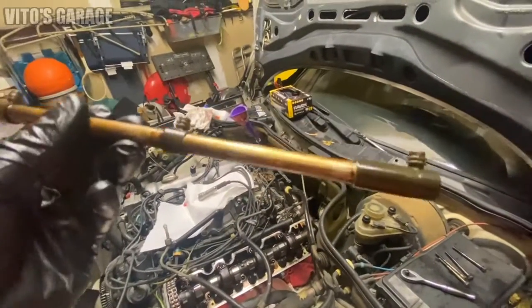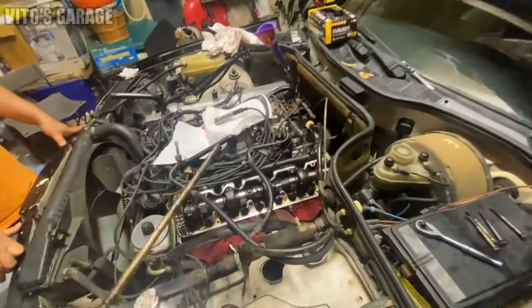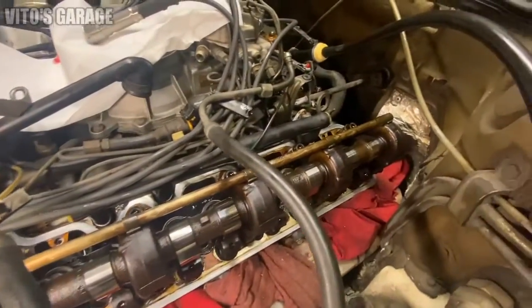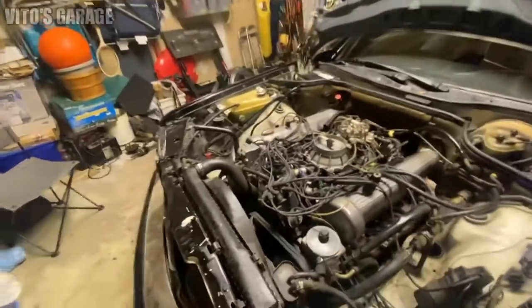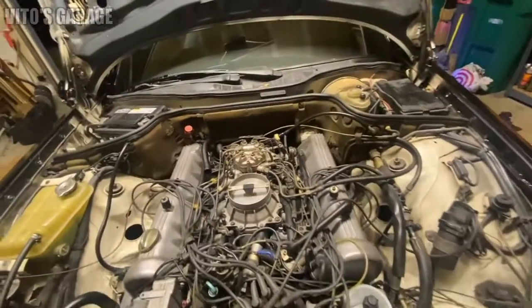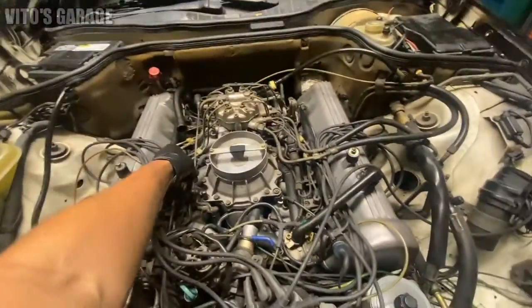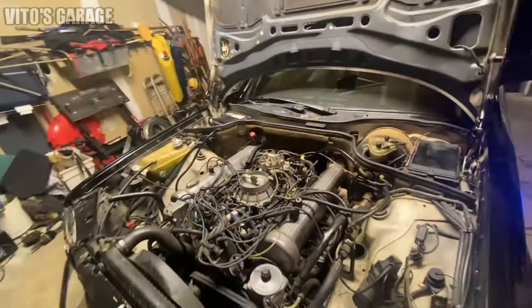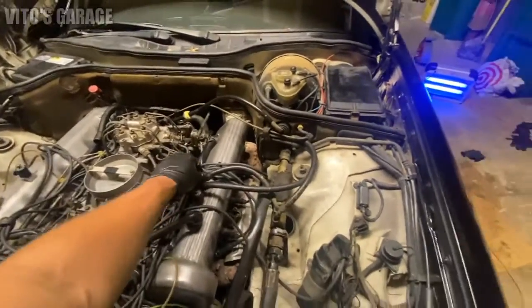The chain needs to be replaced. We got these oiler kits replaced — all good to go. We just finished everything. It's pretty late. Installed new valve cover gaskets, cleaned everything, lubricated all the linkages, and installed the camshaft oiler kits. Transmission was refilled and all that. We're about to start it up to make sure there's no leaks.